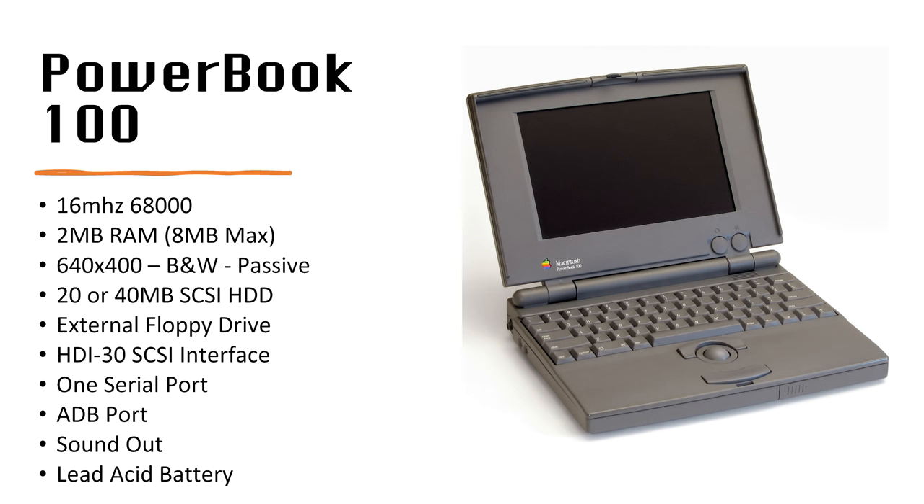Two tidbits about this model: if you are repairing one like I did a few days ago and you've recapped all the caps on the display and you're starting it up for the first time — if the brightness knob doesn't work, don't worry. The brightness knob only works once the system is fully booted up. So don't go through the hassle I did. Also, as you've already seen with the proprietary SCSI port and everything, these machines were a little bit different than your desktop Macs because they had to fit everything in a package. An external floppy drive that is a little special, plus the SCSI port — you're going to need adapters and converters when working on these systems.